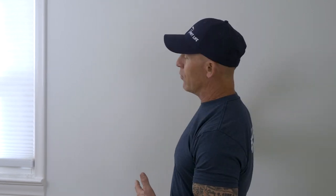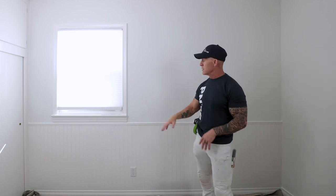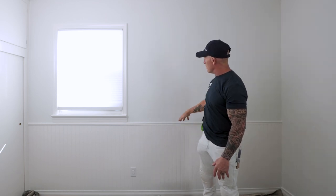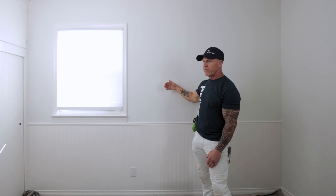If I was doing a candy apple red over the top of this white, it's probably going to take somewhere between five and ten coats to get a true candy apple red that isn't extremely translucent. And you're still going to be building up overlap marks. Those overlap marks are going to be darker than the middle portions. What happens is if your first coat has any lights and darks, they just build on top of each other and continue to show even after ten coats.